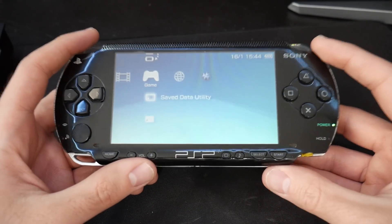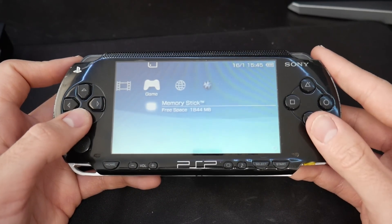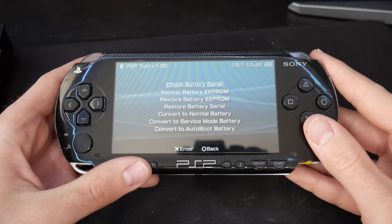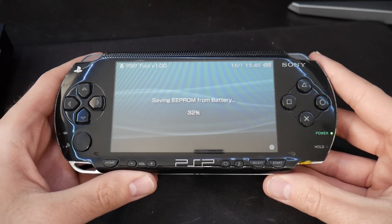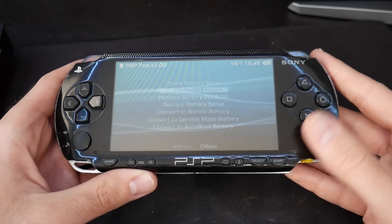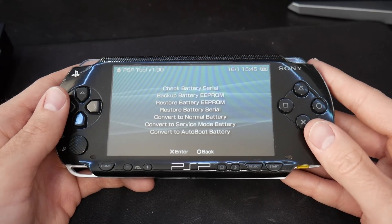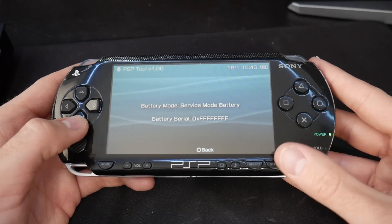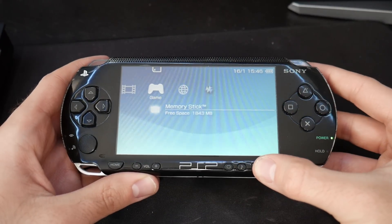Back at the PSP - it should all be set up and my PSP already has custom firmware running, which is what we need. Make sure you have a PSP 1000 model with custom firmware and the battery you want to flash already in the PSP. Go to Game > Memory Stick and fire up PSP Tool. Go down to Battery Options, inside of here we're going to first back up the battery EPROM just in case, then go to 'Convert to Service Mode Battery' and press X. Our battery serial has now changed.